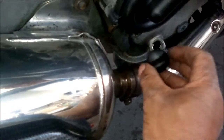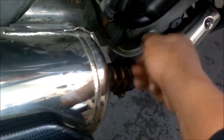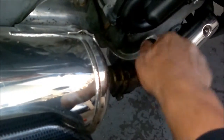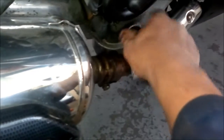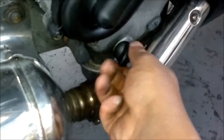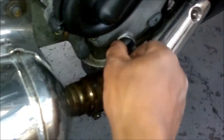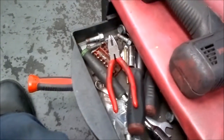Back again on the Gilera Nexus 500 plate — how to check your engine oil. This screws in here, that's how it would be normally. Screwing that out, you come along, unscrew that, get your bit of cloth, rag, paper tissue, whatever it is you're using, and wipe it clean to start with.